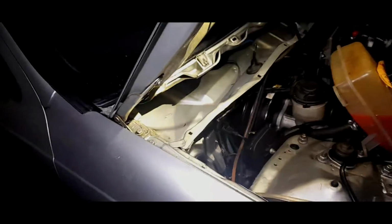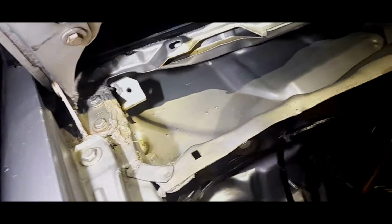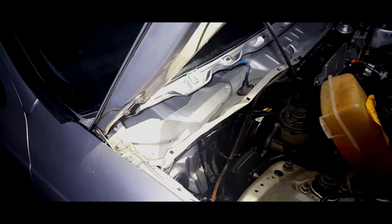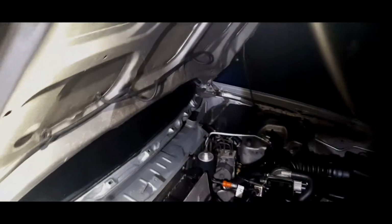At the end of the day, it's all been massaged so that the water goes straight into the scuttle as quickly as possible, and not lurks around in cracks where it shouldn't be, and that is half the cause of leaks really. But now I'm going to vacuum the inside of this seal.